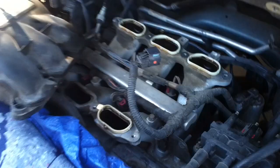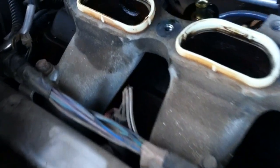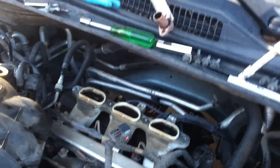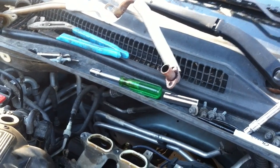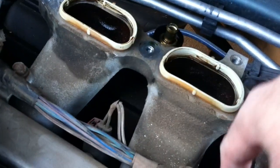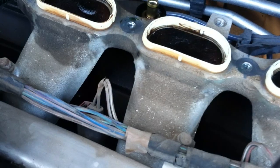The reason I did this, I'm going to zoom in right in there, and over here are the two back screws for the rear valve cover. Now, unlike the Mark 4s and previous, you cannot remove the windshield wiper assembly. This is part of the bulkhead. But if you take out the air manifold, which is basically 8 bolts and unplugging a few things, you can actually see these bolts, so you're not working blind.